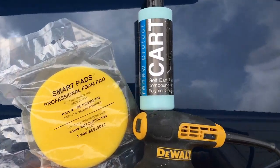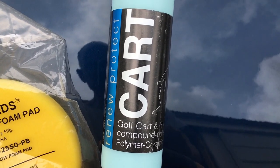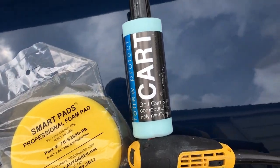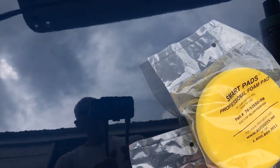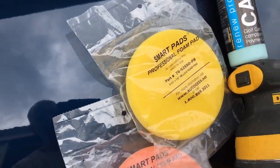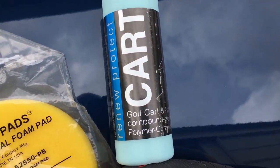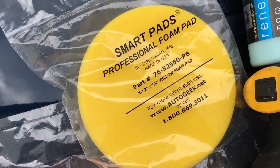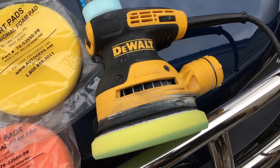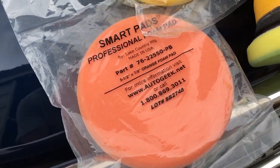Here is what we're working with today — our cart product, which is a one-step product that leaves a ceramic and polymer sealer, so it's a very strong one-year product. The advanced abrasives in cart will begin to work as a compound — as you saw with the wet sanding scratches — doing heavy corrections on oxidation and scratches, and as you work them, they break down to a fine finish polish. For that reason, we'll start with a foam cutting pad in combination with our DeWalt three-amp sander with a five-inch pad, and probably follow that with a light buffing of a polish pad.